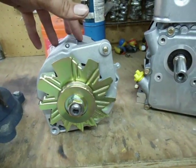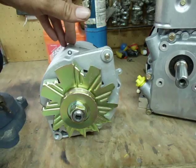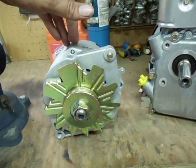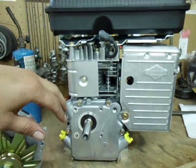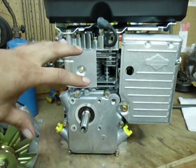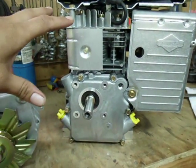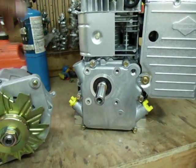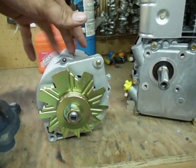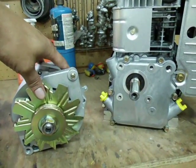That's what's different about this alternator — I had it built to self-excite at about 600 RPM. I'll just find a spot on my ball valve carburetor setup that I prefer this to run. I'm shooting for around 1,100 to 1,500 RPM basically. And as soon as I start this thing, it will self-excite and charge. I won't have to play with the ball valves to rev it up to get it to excite.